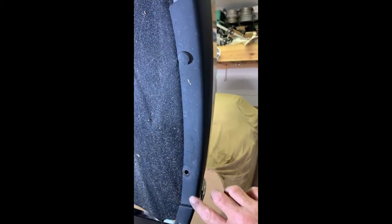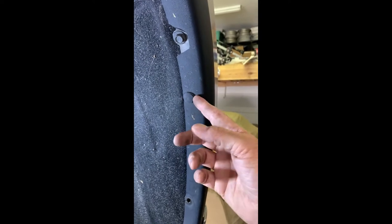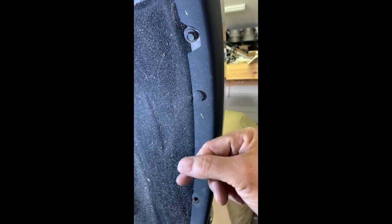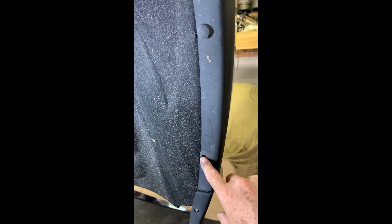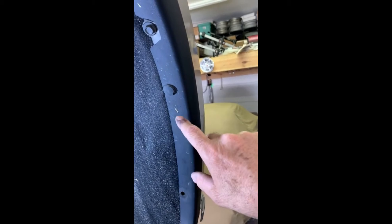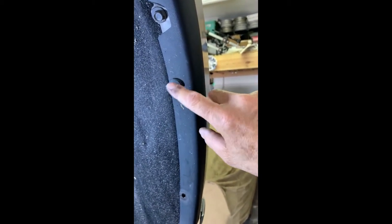Tires are off. I've seen other videos mention plastic clips — the kind where you get behind them and pop the top out. Some people say they're plastic-riveted in place and you have to drill and cut them out. This front bumper has been worked on before, so they put in some aftermarket ones, which are nice and easy — get in and out very quickly. We're going to pull this piece off, which is just plastic-clipped in.